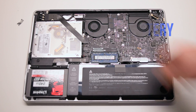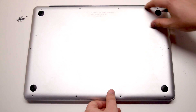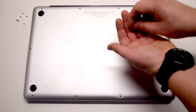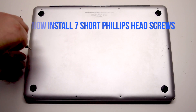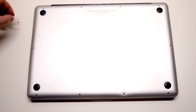Reconnect the battery and place the cover back. Install the three long Phillips head screws first, starting in the top right corner going left. Then install the seven short Phillips head screws starting in the top left corner, going around the contour of the MacBook.